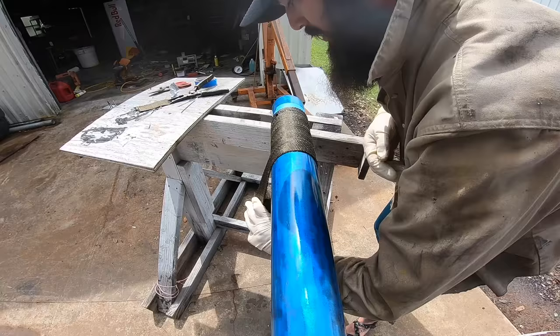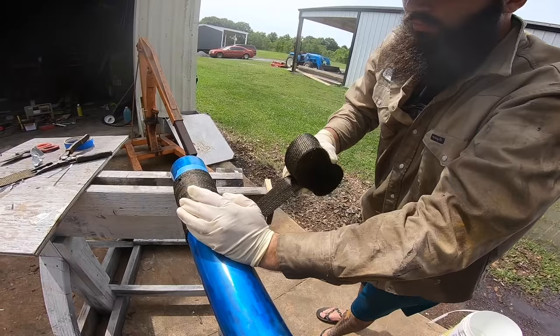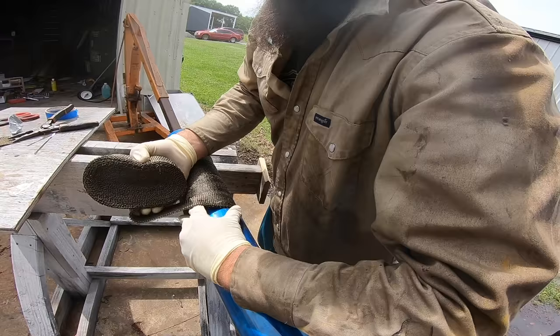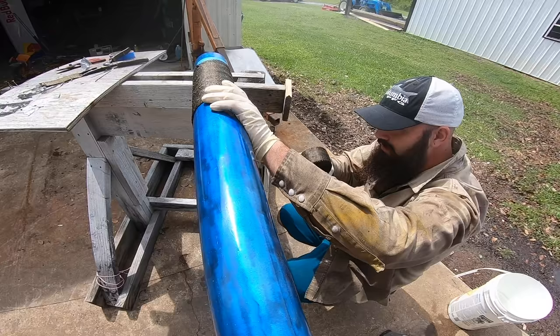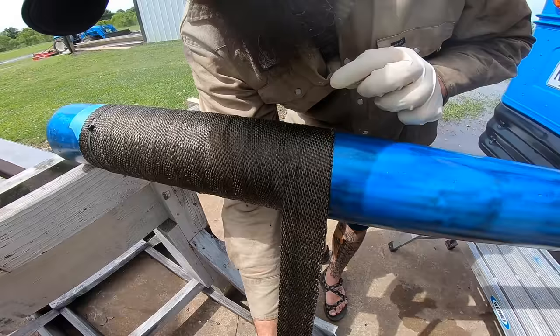I'm doing about a quarter inch to half an inch of a lap. The reason we put it in water: one, it's going to help with the fiberglass — the flakes from the cloth will stay down. Second, and probably more important, it will shrink when it's dry. So if you wrap it nice and tight while it's wet and then let it dry off, or heat it up by turning your exhaust on, it'll shrink it down and make it even tighter.